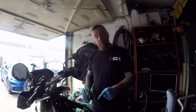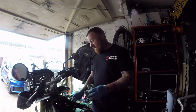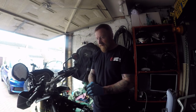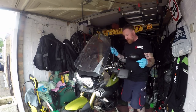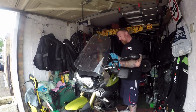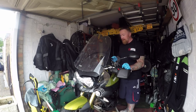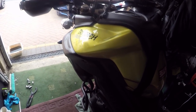Now I'm going to do the oil — filter's back on, refill with oil, check the water. It's only a tiny bit down, so I put a bit of nice fresh antifreeze in there; it's quite a good colour so I'm happy with that. Fresh oil in it, tank back on, and then we'll see if she starts — that's the fun part. The whole pain is getting all the bloody panels back on because there's so many of them. Believe me, what feels like several hours later, got most of the panels back on — just the one side left to go back on. Tank bag was a bit of a bug because I had to unstrap that. All the screws are going back in — remember where you got them from. Make sure you plug in your indicators as well and test them, which I've done. It's all back down again, looking like an 800 Tiger.